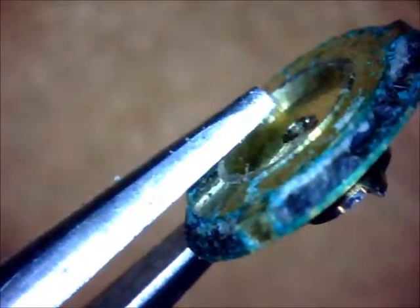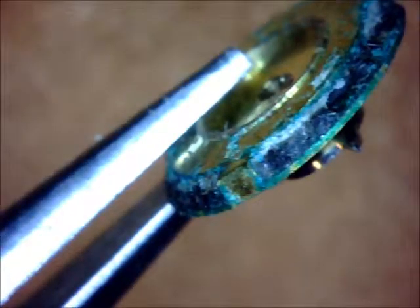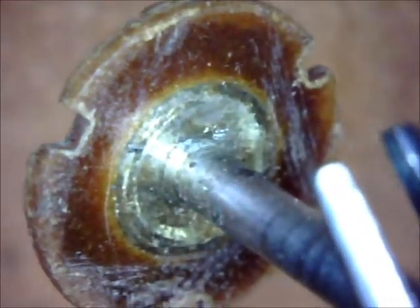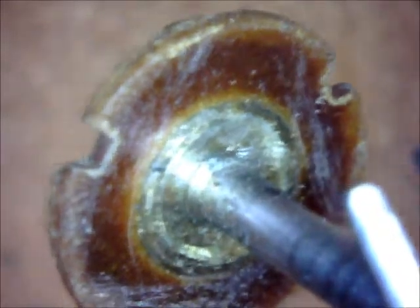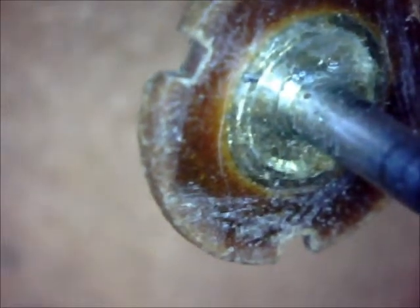Clean all the epoxy out and rubber pieces, and you make a new one. You can make it out of rubber if you can find it — that's exactly 0.55mm thick — or like this one, which is made out of a piece of a circuit board from an electronics device. The circuit board is exactly 0.55mm thick.